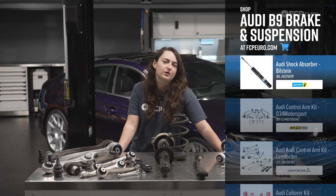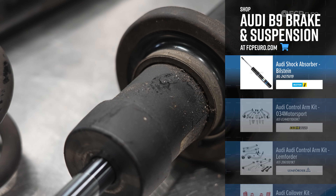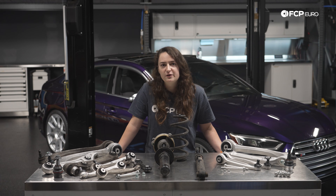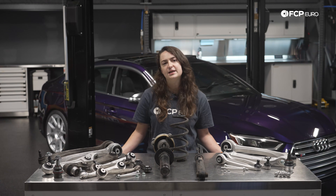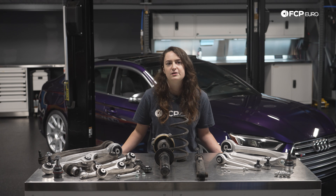Standard dampers, or passive suspension, are traditional fixed-rate dampers with no electronic control. Unlike the DCC, they are factory-tuned to balance comfort and performance at a fixed rate, paired with a conventional steel coil spring. They're firm enough for spirited driving but always the same stiffness, which can feel a little bit harsh over rough roads or expansion joints. There's no adjustability compared to the DCC, but these are generally more reliable and cheaper to replace. The pros are that it's simpler, there's less to go wrong, lower cost of replacement, and more predictable and consistent behavior. The cons are there's no ability to soften or stiffen the ride on the fly, and they may not strike the ideal balance for all conditions depending on how you drive.